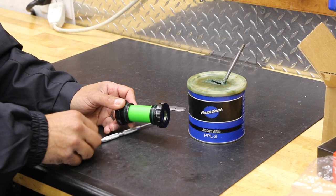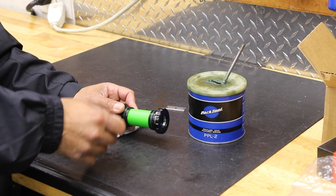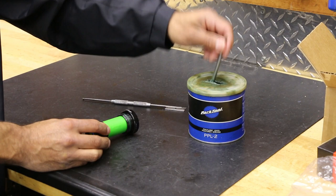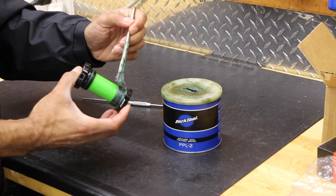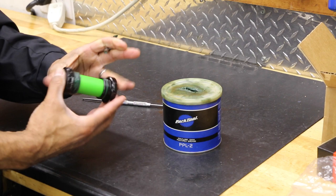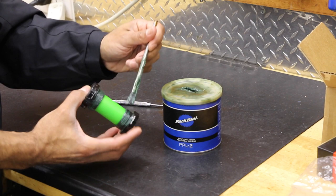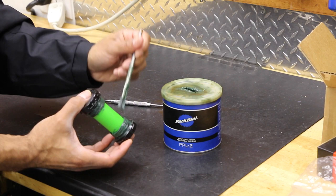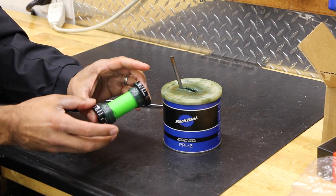Most likely if it were permanent, it would come in a wet form for you to apply and then dry over time. So we're going to lube this up — I cut a little square hole in the tube, and I've got a brush, though you can use your fingers. I'm going to put a pretty good coat and get the grease in between every single thread. You don't have to cake it on, but be liberal. This is an area that gets a lot of water, debris, rain, and mud. The more grease the better. A nice true torque setting means less chance of creaking and less chance of seizure. We don't need excessive grease since it'll build up on the outside edge — the cleaner job you do here, the less cleanup after installation.